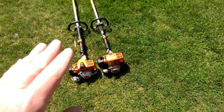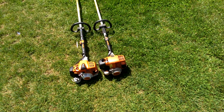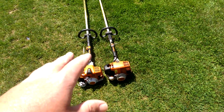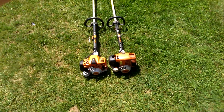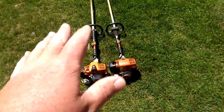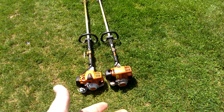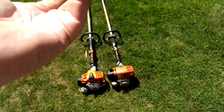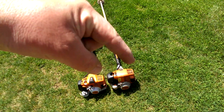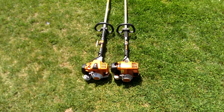That means if you want to start with the piston up top and the spark plug ignites the fuel, it pushes it down. That's where your power is. We'll start it from the top. The piston goes down. When it's down, it'll come back up, and on its way up, the exhaust valve will come down in the engine and allow the exhaust to go out the other side of the valve. There's 2 valves doing this, going up and down, an intake and exhaust, intake and exhaust.